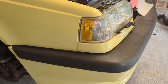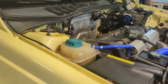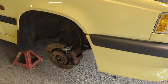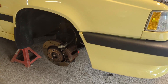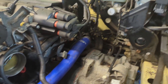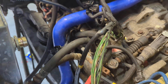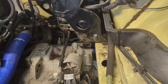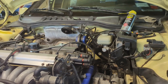I think I'm ready to drop the subframe. Before I drop the subframe, I got to put the engine support up here. Let me go get the engine support, support the engine, then drop the subframe. I think everything is disconnected from it. I got the ball joint bolts pulled out, so as I lower the subframe, I'm going to tap the control arms out of the bottom of the knuckle. I still got a few bolts holding the transmission on — all the top bolts are off, the bottom bolts are still holding it. I got the bolt out of the mount, out of the ground wire, out of the wire harness sleeve. The anti-sway bar is disconnected from the links. Let me put the engine support brace on so we can drop the subframe.